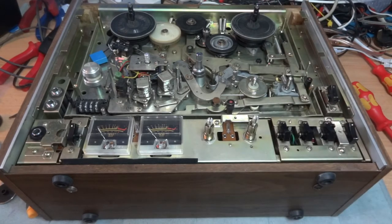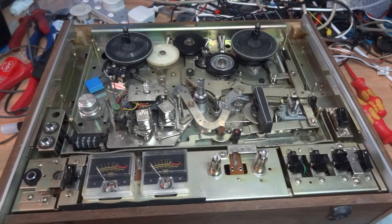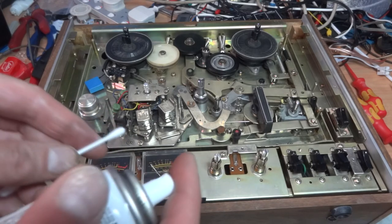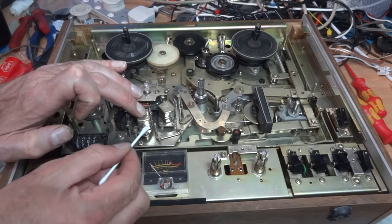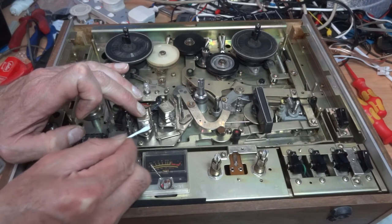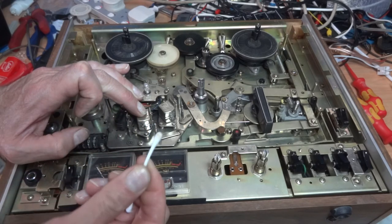Those are all the parts that come in contact with the tape - give them a nice good clean, really try to shine them up so there's a nice reflection with no dirt marks. I'm going to show you the tape heads - I'll just do the record head but they're all the same. Spray a little bit of solution on a cotton bud, get in there, hold the head to support it a little, and use a backwards and forwards side-to-side motion. Get the whole head because tape runs along the whole head, and you'll be surprised - even the corners pick up dirt.